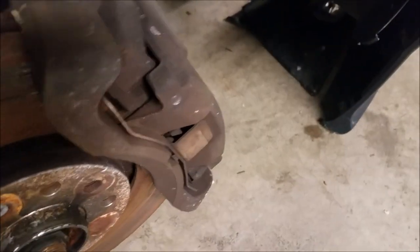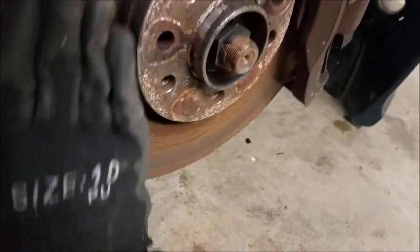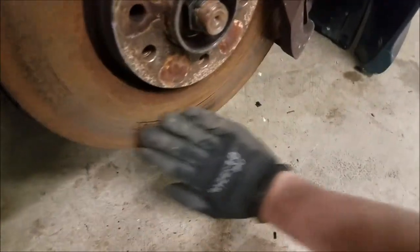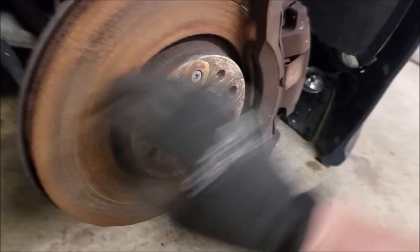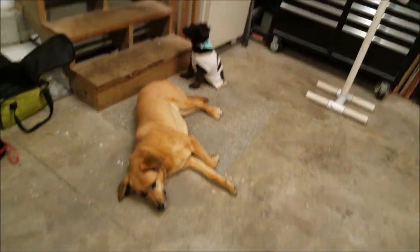So clearly this car needs some brake work. Passenger front coil is not broken, which is good. Brakes are not gouged, which is really good. Pads have good life to them. The car was definitely sitting for some time so I believe this is just some surface rust. Can't really tell on the backside. Suspension-wise, everything seems in decent shape.